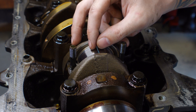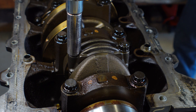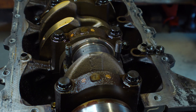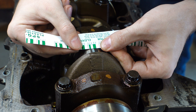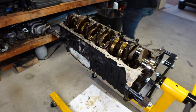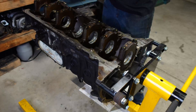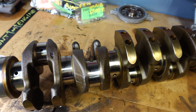I'm taking general oil clearances here using plastigage, which is basically a thin piece of plastic that smashes down and gives you a rough estimate of the clearance between the bearing and the journal, down to the thousandths or ten-thousandths of an inch. A more accurate way would be to use a dial bore gauge and a micrometer, but for the purpose of this teardown and per the FSM this will do. All six rods are within standard clearance, and I'll hand this information over to the machine shop so they know where the engine was at beforehand. I did the exact same thing for all six main bearings — the crankshaft bearings — and all of those were in spec too. That's going to wrap up this teardown. If you liked this video, please give it a thumbs up, subscribe to the channel, turn on the notification bell, and check out the previous videos if this was interesting to you.